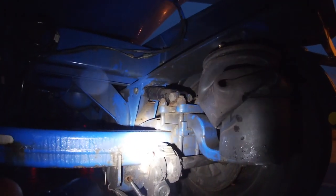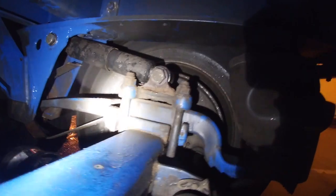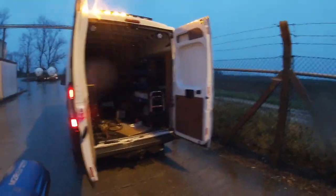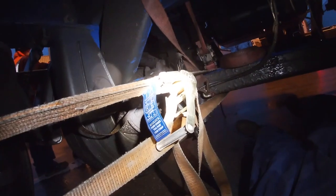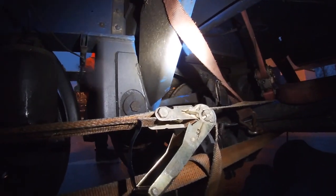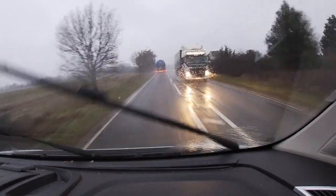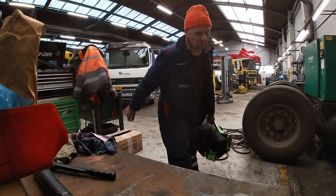Off to another breakdown - this one was this morning actually. This was a broken trailing arm on a trailer; it's quite serious - it snapped in half and spread apart, so I can't move it until we do something about it. Generally if you're going to do big work, you need a big van with flashy lights on it with a compressor so you can use air guns. What we're doing here is recovering it, using a set of lorry span sets. I've had to pull the axles together first and then strap it up so the spring doesn't move too much and the axle won't skew around. Of course there's the escort of the vehicle back to the workshop, because that is a big job requiring big tools.